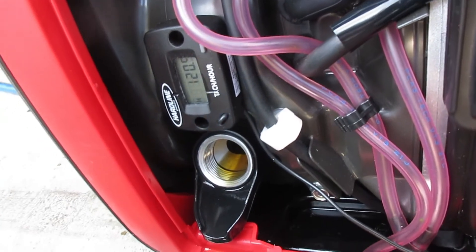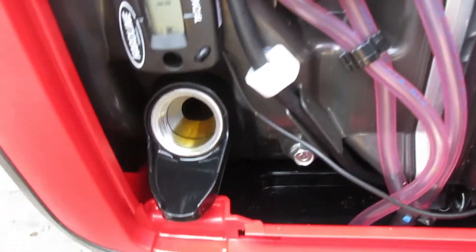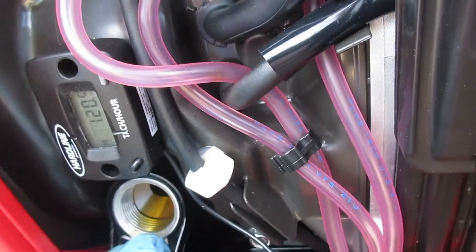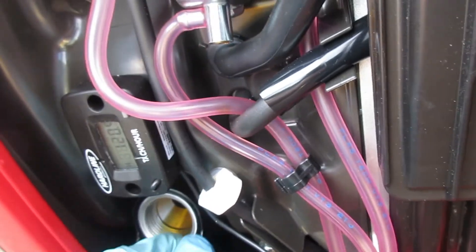For the fill level, don't bother using a dipstick. It's right about here — when oil starts dripping out into this rubber thing, let it drip and you are full. Once it's up to those top threads, you're good to go. Change interval is around 120 hours.